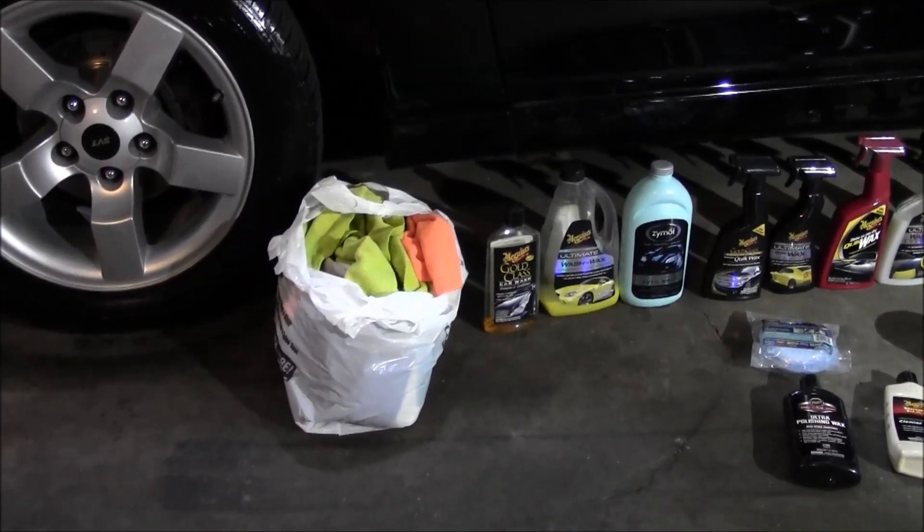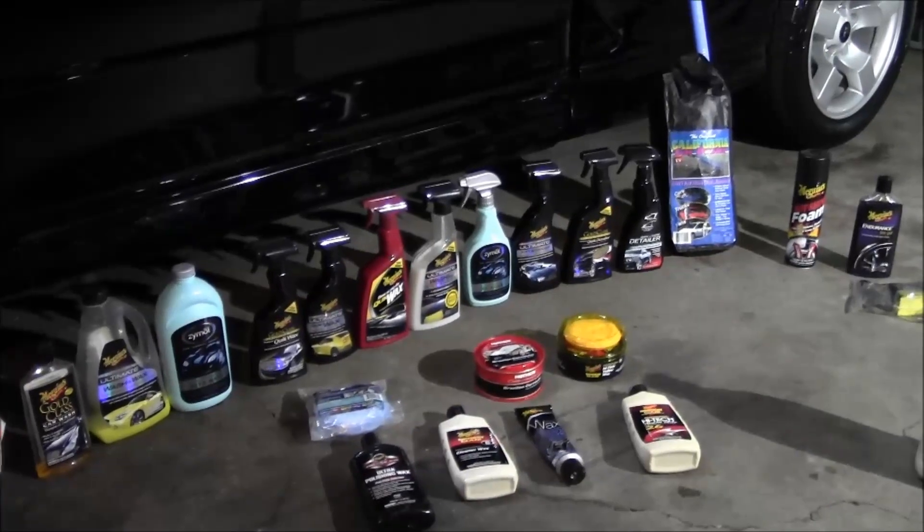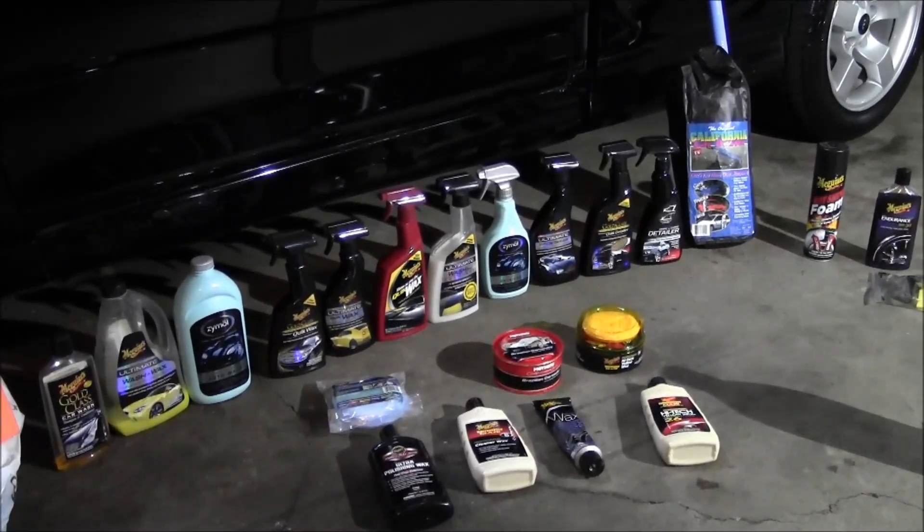If you've been doing polish work, you should have a bunch of microfibers laying around. If you do these spray products, use two towels — you might go through four or six towels total wiping your vehicle off. I'll wet product onto one towel and wipe, then use a separate towel for the final drying. You're spreading the product with the first towel and doing a final wipe with the second — you get a much better result that way. If the wipe towel gets really dirty, grab a new one or swap your dry towel to be the wipe towel and grab a fresh dry towel.